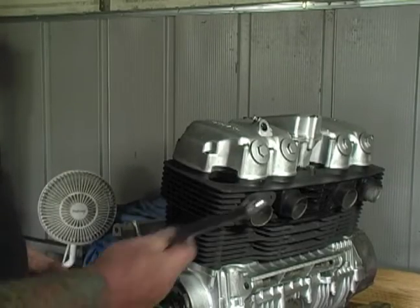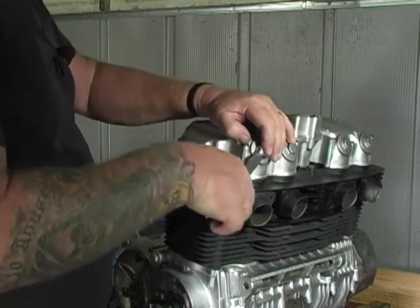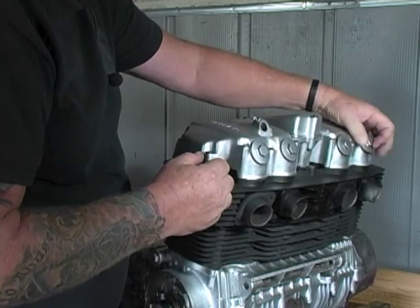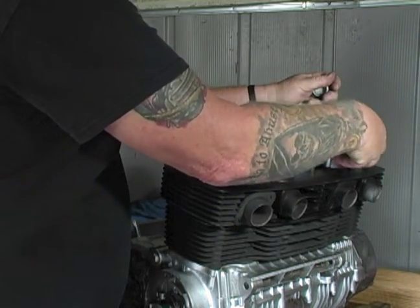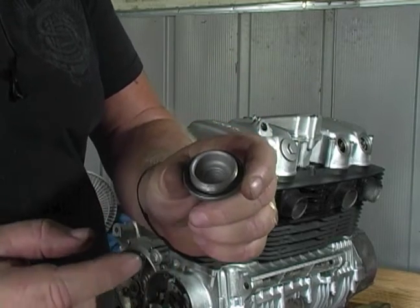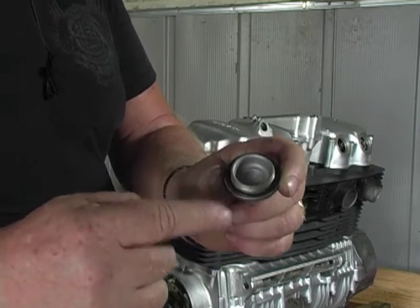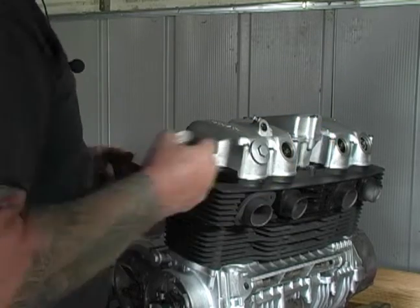To begin this project, we're going to take a 17mm wrench on this single overhead cam 750 and remove all the valve adjustment covers. Note that in the 750 there's a rubber seal inside there, so if you're working on an older motor and you're not sure about the quality of that, now's a good time to replace those to help prevent oil seepage from messing up the appearance of your motor.